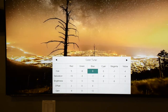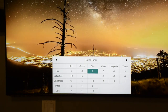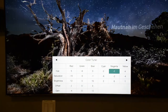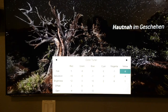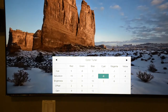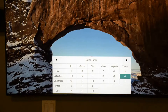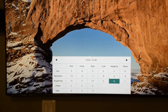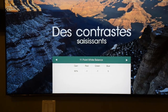I recalibrated this TV about 10 times to make sure I was getting the correct and most balanced measurements to give you guys. On Cyan Hue put 0, Magenta Hue negative 1, Yellow Hue 4. On Saturation: Cyan negative 6, Magenta negative 2, Yellow negative 4. On Brightness: Cyan 2, Magenta 6, Yellow 1. Now we're going to go to the Gray Steps 11-point balance.